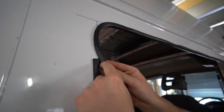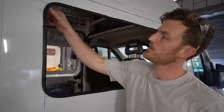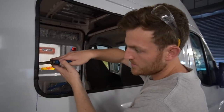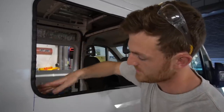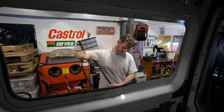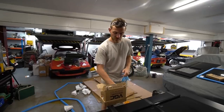I'm going to cut off a little bit extra than I need just so that it's nice and tight. I don't know if this is something you're supposed to do, but this edging trim can be a bit loose, so I'm just taking some pliers — because there's metal inside here as well as rubber — and I'm just crimping it down to the metalwork of the van so it sits a bit tighter. Here comes the moment of truth.